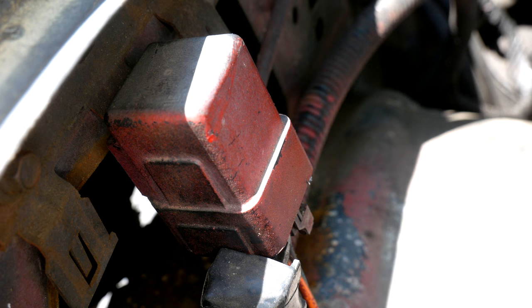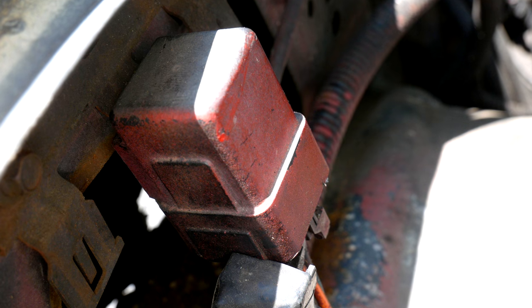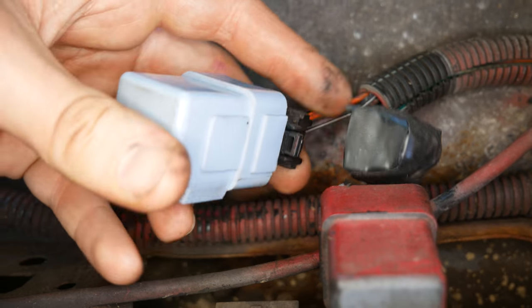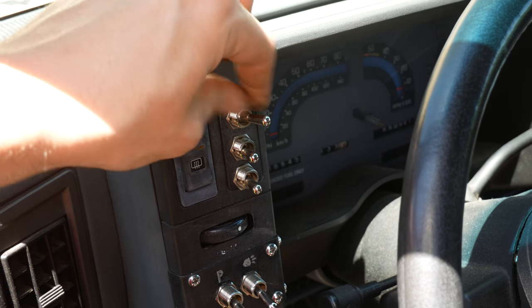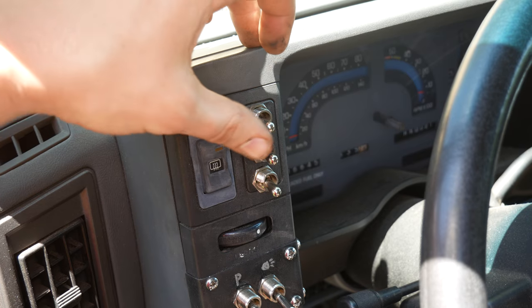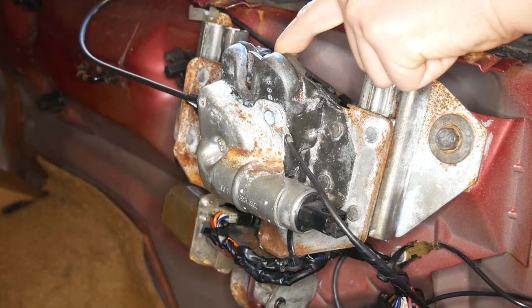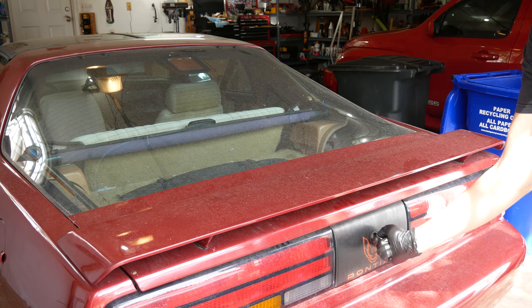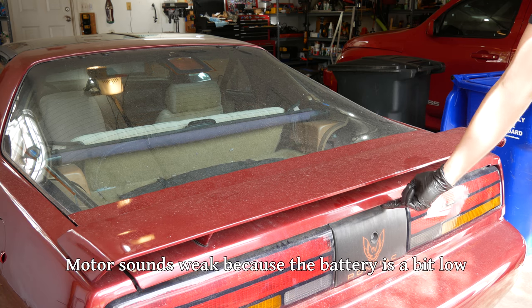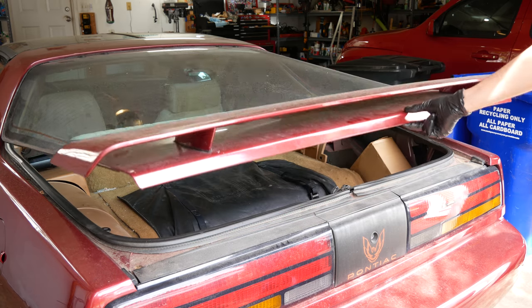Since carburetor-swapping the Blazer, the fuel pump is run off a toggle switch on the dashboard, which means the control side is a very simple circuit and the power side has a load on it - the fuel pump - so we can test the relay in real-world working conditions. All we have to do is unplug the existing relay and hook up the gray one, and when we toggle the switch - nothing happens. So it sure seems like that relay is kaput. To totally confirm this, we removed the working fuel pump relay from the Blazer and popped it into the wiring harness on the Firebird, and with the working relay in place the electric portion of the pull-down assembly is functioning. The bad relay explains the intermittent function and a lot of the weird symptoms.